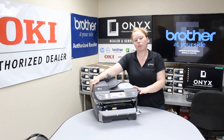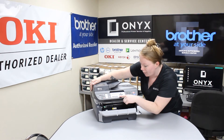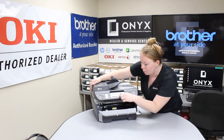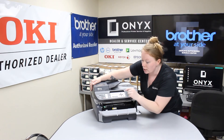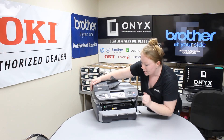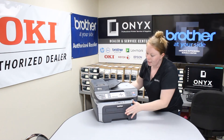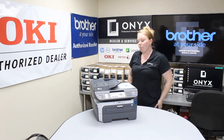With this particular machine you will need to reset the drum. You're going to hit the clear back button right here after it says the cover is open on the front. Now it says replace drum — you're going to hit one for yes, two for no. So we're going to go ahead and hit one for yes. It says replace drum is accepted. Close your cover and make sure it snaps in. Then your printer should calibrate and you should be good to go.